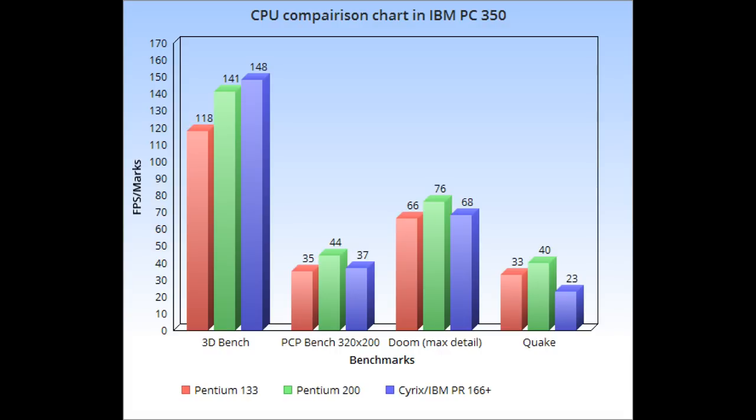So I was playing around this time with aspect ratios for some reason. And so it's going to look a little weird, and it's a little bit muddled, and the sound works. You can hear it fine, but it's a little bit muddled. But yeah, if it sounds weird, remember, we're using that Opti chip from that sound card, so it definitely sounds a little off. I'm not really an audiophile, so sometimes I can't really tell, but even to my ears, a couple things like Doom didn't sound quite right, because remember, the sound card does not have an actual FM chip on it, a Yamaha OPL chip. So just keep that in mind.